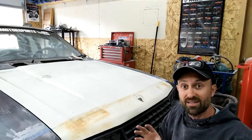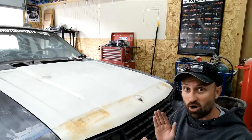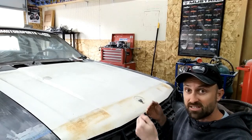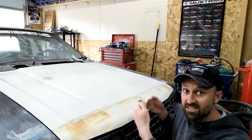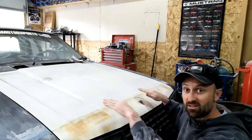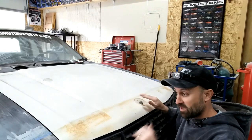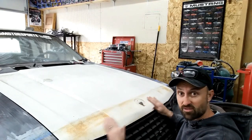All right, so at this point, the hood has been balanced cross car, left to right, it's even. It's also now balanced on fore aft, both sides, they're even. And now I've balanced the rear vertically against the fenders. The last piece of this is you need to balance the front.